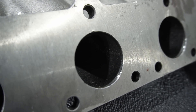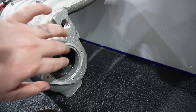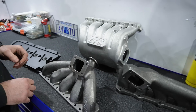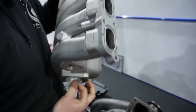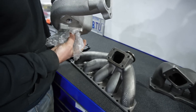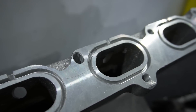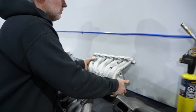Clayton, get lots of b-roll inside the runners and the mating surface. It looks like they utilize the stock o-ring setup for the manifold as well — for the throttle body and for the runners. So you can just go to the dealer or hit up your local parts guy and get that stuff ordered. It comes with breather hoses and brackets and stuff like that, so it comes with everything. It also comes with standard port injection stuff. The casting overall — there's nothing too crazy inside of it, but we'll show you more of that.